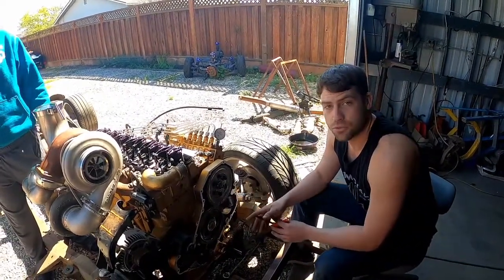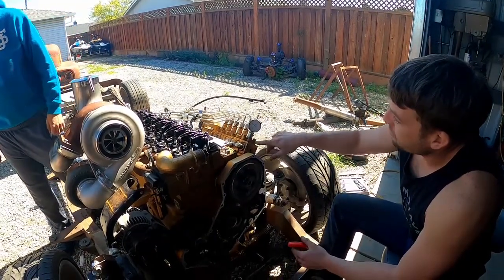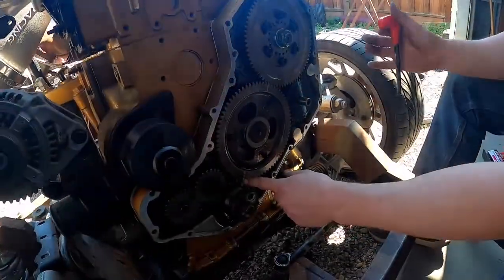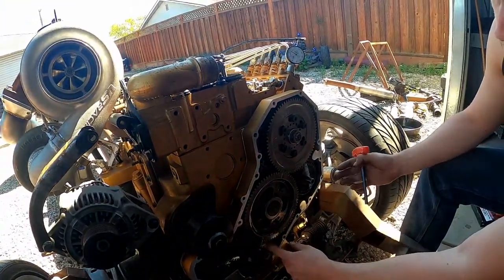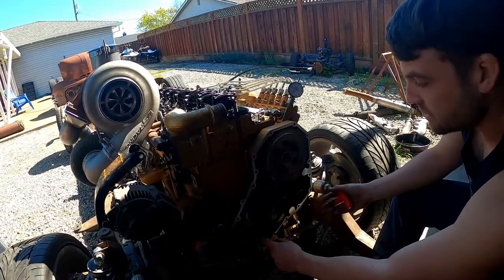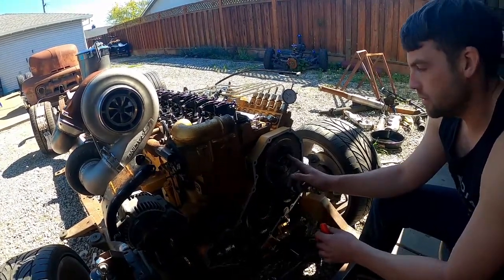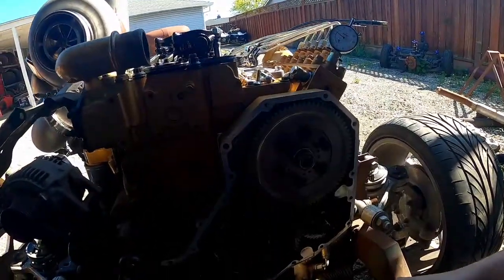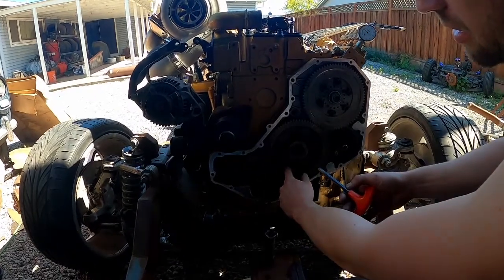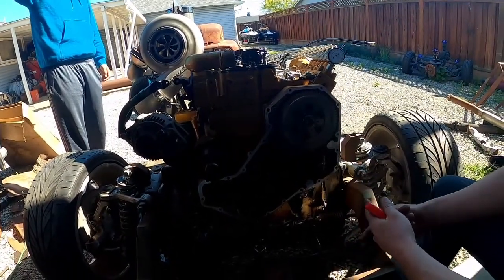Since mine is already set to the correct timing I can't really show you exactly how this goes, but I'll explain it. We're at 0.3150 on our dial indicator. Ordinarily when you come down to your timing marks here, when set to 0.3150 — at least on mine — these were actually forward a bit too far. So what you do in the next step is loosen the bolts that hold the adjustable gear on and remove the locating bolt right there. Then you rotate the crankshaft counterclockwise again until the timing marks line up perfectly, and tighten the bolts back down on your adjustable pump gear.